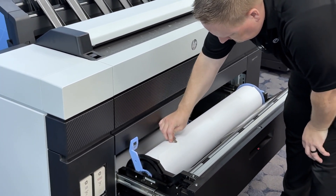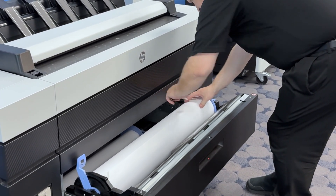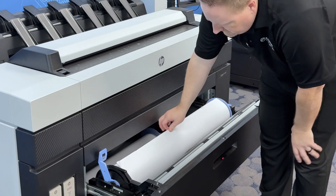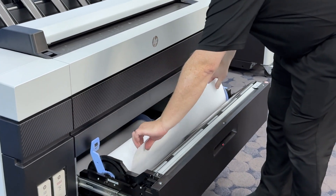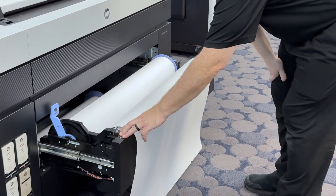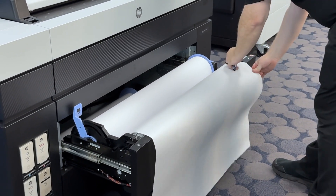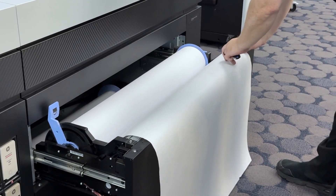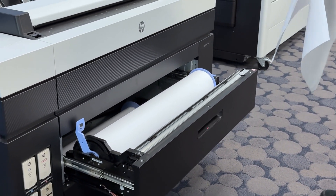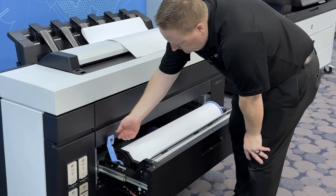Use the box knife to cut through the tape. Now that we've cut the tape, it's recommended that you trim the outer layer of the roll off so that you have a clean edge when the paper goes to feed. Grab the roll and pull about 24 inches of paper over the top of the drawer. There's a cutting edge on the drawer that you can use to trim the paper — hold onto the edge of the paper as you cut.